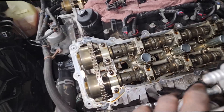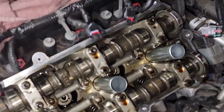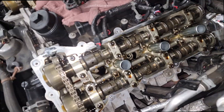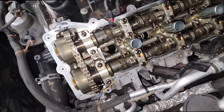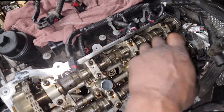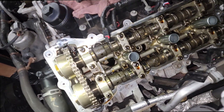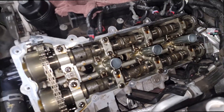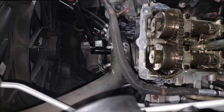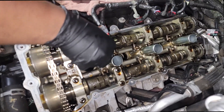Rotate it over until you move off those other remaining lobes. What did you say about that silver stuff on it? Yeah, this one's bad too — it's like on all of them. A guy named Tom Cook on the internet enlightened me on that: it's powdered metal shavings. That makes sense, because this is magnetic inside that valve cover — these little rocker arms getting chewed up, camshafts getting chewed up, it's all gonna be attracted to those. Powder metal shavings.